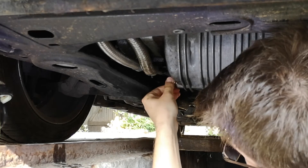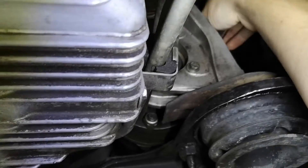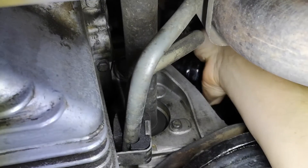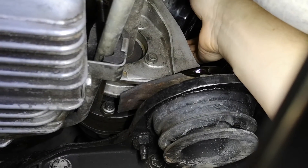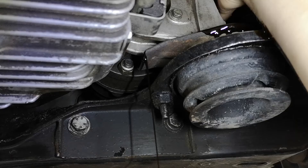Tighten the plug and proceed by removing the old oil filter. Use a tool if needed — I'm usually able to undo it by hand with some effort. You're about to see why the rear engine mount gets damaged so easily: the reason is that rubber doesn't really like being soaked in oil. This is another design flaw which, sadly, we can't undo.